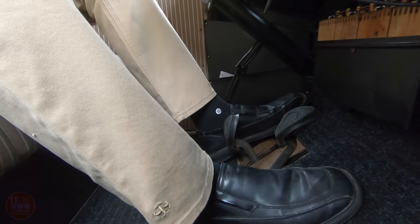Now we're coming to a stop. I use engine braking to slow down in high gear, then switch to low gear to get even slower, and then at the very last few feet I use the brake pedal — just barely. I hold the clutch into neutral with my left foot and lightly apply the brake with my right. Now pressing the clutch, we're going again — actually going down a very steep hill, so I'm keeping it in low gear. I can slow it just a little and then make the turn.